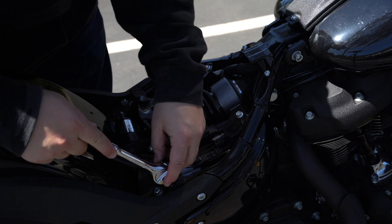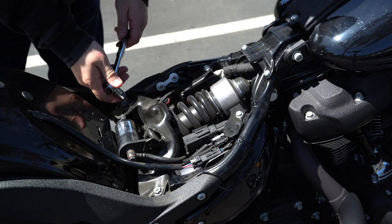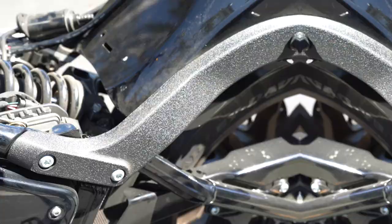The first thing you'll want to do is detach the remote reservoir for the factory shock from its bracket. It's super simple — just one bolt holding it in place. After that, go ahead and remove the metal guard that's in there. I'm pretty sure this serves as protection for the shock. I think you can still get the factory shock out without taking it off, but it's way easier to remove if you do. After that, loosen the top bolt holding the factory shock, but don't remove it all the way. You want the factory shock to still be loosely held in place.